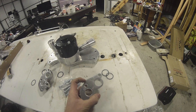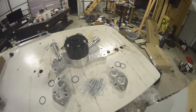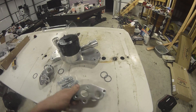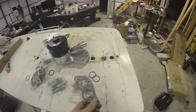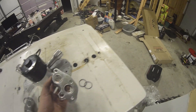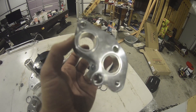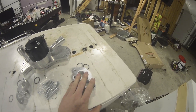You're going to need to grind some of this off before you install it on the vehicle. The other issue I've found with this kit — that not a lot of people have realized yet — is that these are the LS water pump style seals. If you put this on and flip it over, you can see right there in the corner in the middle of the screen that it doesn't quite get covered up by the block adapter, which is going to cause a leak. So I'm going to put some RTV on this, which should be okay.